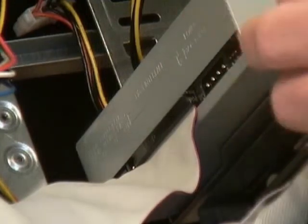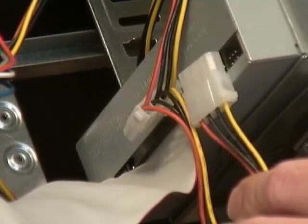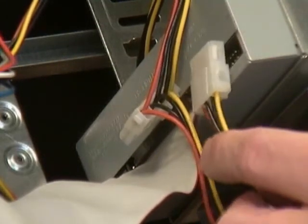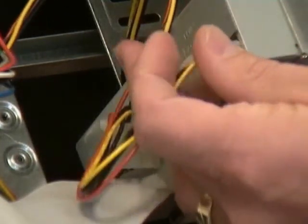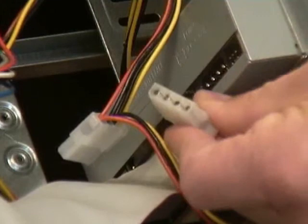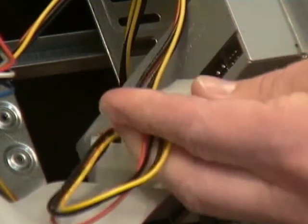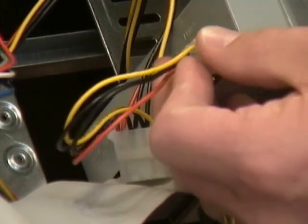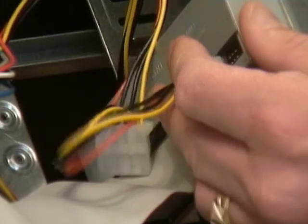It's configured as the master drive on our secondary channel. Let's go ahead and apply power to it, and then we'll connect the other end of our audio cable. So I find a Molex plug, the same plug that was used to connect our hard disk drive to power. Use the connector. I notice that it's keyed so it can't be inserted back side down. Get the correct orientation and plug it into the connector. Our drive is ready to go.